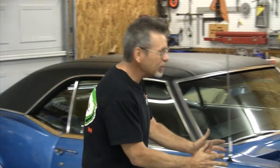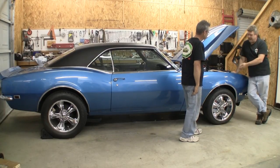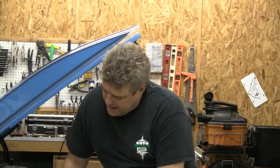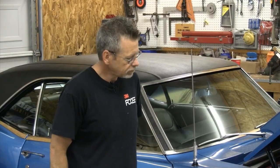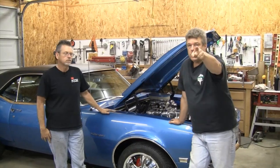Definite improvement. I think it does, as long as it'll drop a little more. My only concern is when we get this front end dropped, what's going to happen at the back. Well, that's part of that snowball effect. We've already got a half-inch drop out of the front end on this side — I did a tape measure and confirmed it. We could drop as much as three-quarters of an inch more from there. We're looking at probably pulling about that much more out of the front end on this car, and I think it'll look better. But then we're going to have to do something at the rear — that worries me with the tires on this car because they're a little wide. We also talked about doing an episode on how to set up a rear axle for these cars because they're not centered in the chassis. That's all we have time for this week. Come back and watch us next time on Auto Resto Mod. Y'all have a great week.